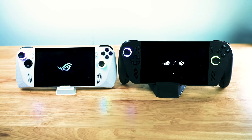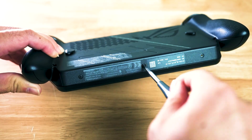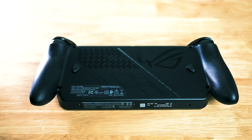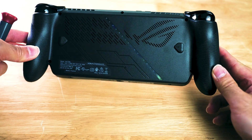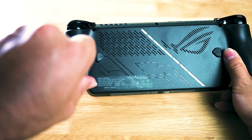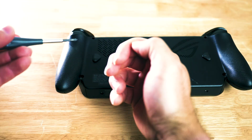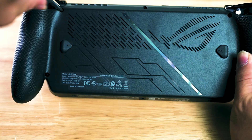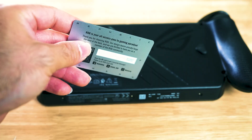Let's go ahead and install it. On the bottom, you're going to see three different screws. Importantly, remember that three of these screws are going to be the smallest set screws. Then from the back of the device, you're just going to unscrew one, two, three, four, five — about five screws. Start off by unscrewing from the bottom and then work your way around. These are going to be quite a bit lengthier compared to the bottom screws. Make sure to set these aside somewhere where they won't roll off the table.